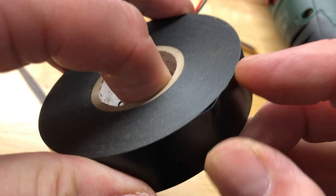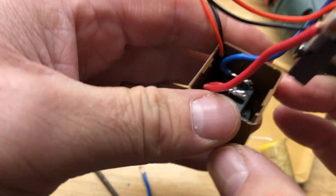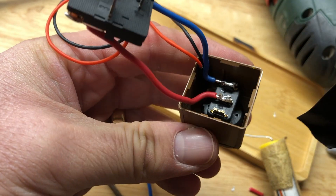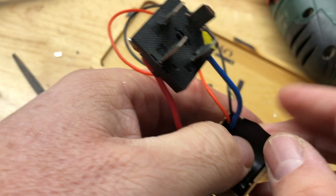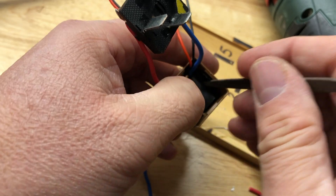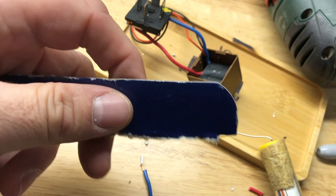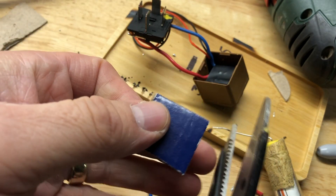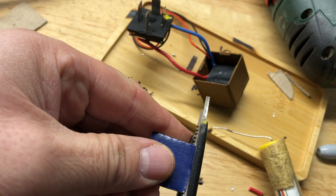We're on the last leg. Take a little bit of insulating tape — this is a belt-and-braces approach — and just cover over the terminals in there, tucking it down the sides to stick to the terminals. Next, a bit of thin cardboard — thin corrugated — cut yourself a square that will fit inside the relay shell.